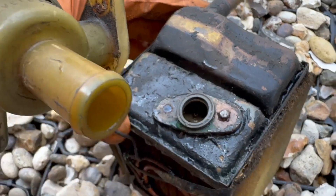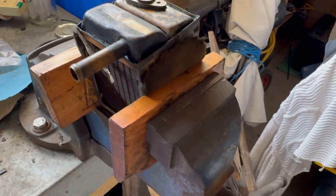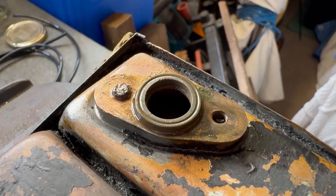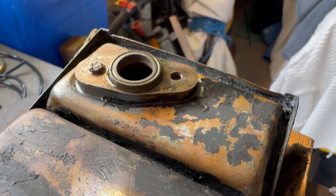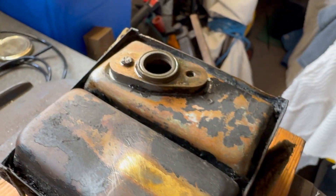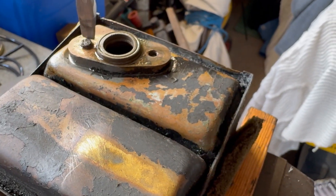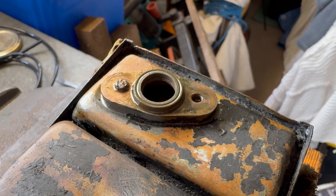There's the offending stud. Let's see what we can do to get that out. I'm back in the shed - let me show you my plan. We'll see if it works, I'm not holding out much hope. I'd like to keep this original heater matrix because it's in really good condition. It's supported by a couple of bits of wood so I don't squash it. The stud is soaking in Plus Gas. What I'm going to do is cut a slit in the top of this stud to get a screwdriver in there. That's my best plan so far.